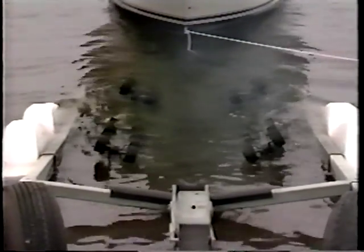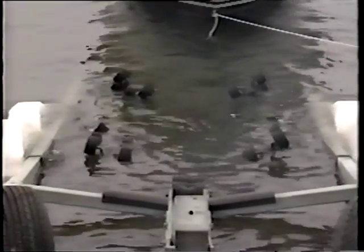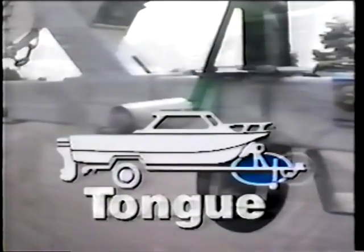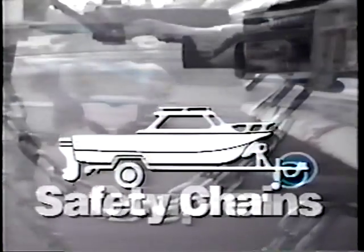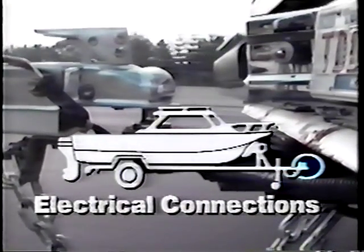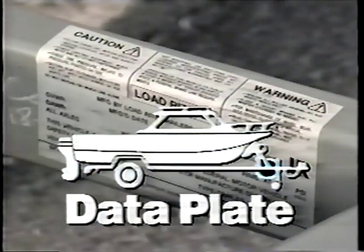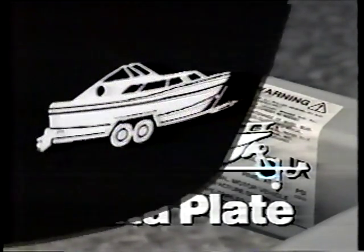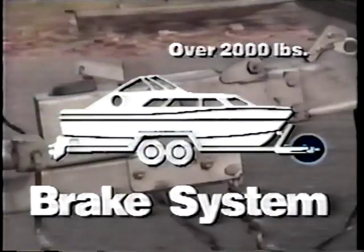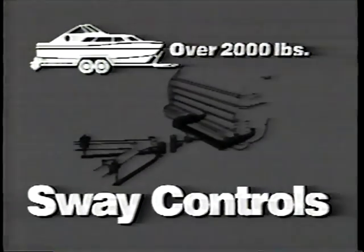There are several classes of trailers within these two basic bunk and roller types, but all trailers, large or small, share certain features. The tongue, the coupler, safety chains, electrical connections, a winch, lights and reflectors, and the data plate. Larger trailers for boats over 2,000 pounds have a specially designed surge braking system built into the coupler and one of many sway control systems.